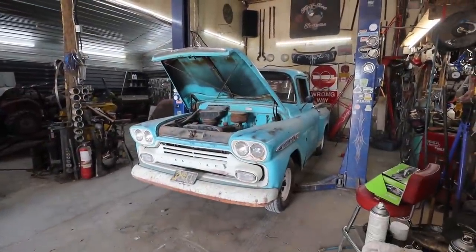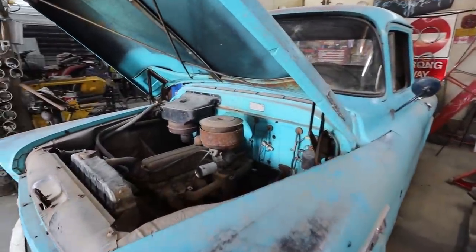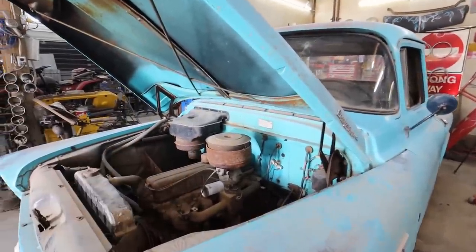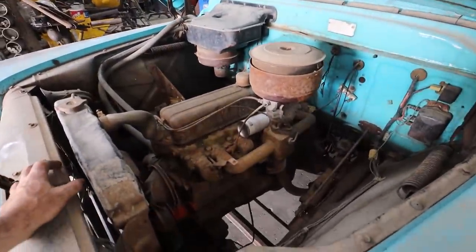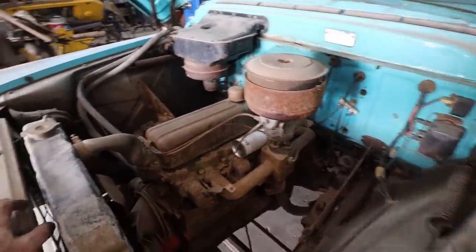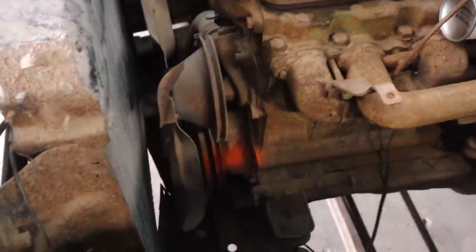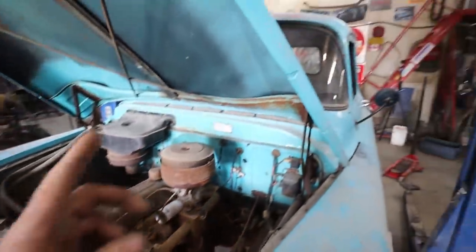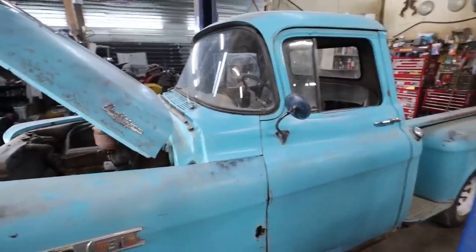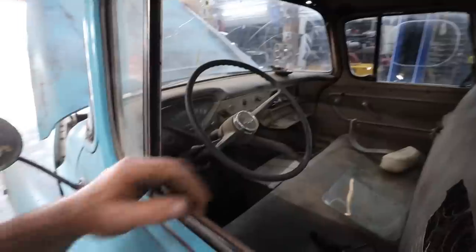Well, it's in. Unfortunately, it's like it's in gear. It pushes fine now. The wheels turn okay in the back, but there is no brakes, nothing. Which is telling me there is no clutch left in there. My little marks down there are still 100% for the amount of turning the wheels did, and it didn't matter what gear I did. I was watching it, the drive shaft was turning and stuff, so I think the clutch is toast.